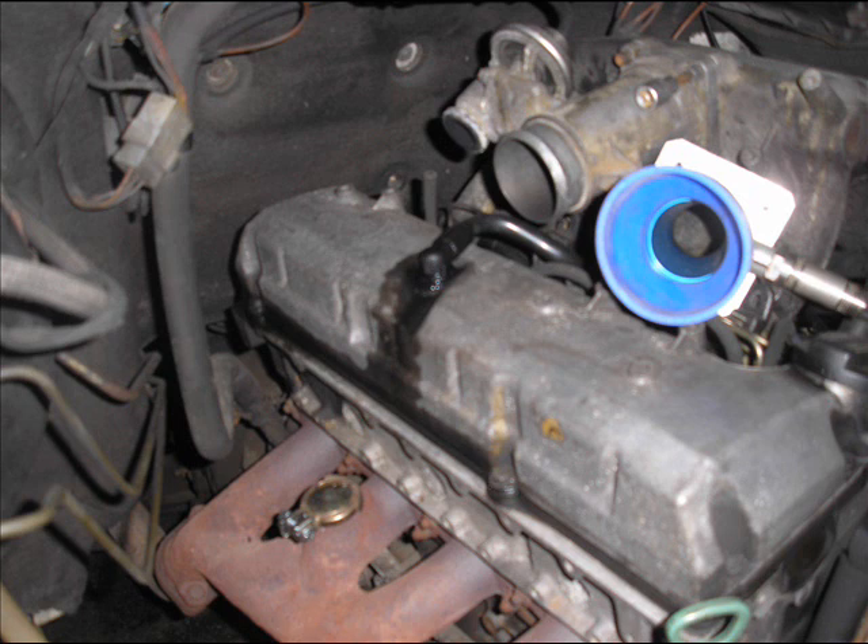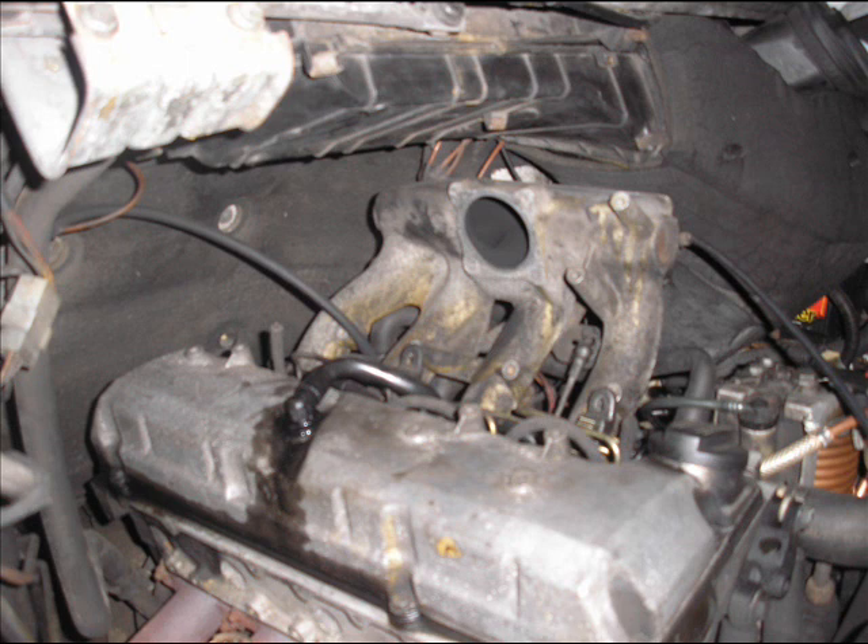There's a bit of an oil leak coming out of the cam. I've got a spare cam gasket — I'm just going to get some Autosol polish and polish the cam up while I take it off. I might as well. Maybe it won't leak then — we never know.